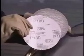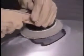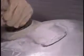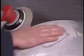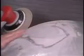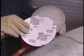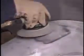Now that the repair material is cured, begin sanding with 180 DA disc. Sand the repair material level with the surrounding area. If 80 grit is used prior to this step, be careful to keep the 80 grit scratches inside the adhesive area. These deep scratches will be difficult to remove from the bumper plastic. Finish sanding by switching to grade 320, feather edging into the surrounding area.